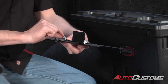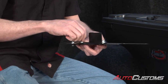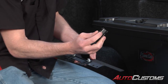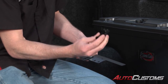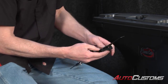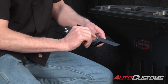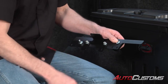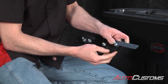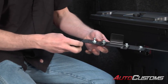Run it up through, washer smooth side towards the powder coat and nylock nut. Next we're going to take our lobe clamps. The lobe clamps have a hole that's off-centered. The high side of the lobe clamp should go to the back of the bracket, and we're going to line up the bottom lobes to the openings in that bracket. Take our washer — just like before, smooth side towards the powder coat — then take our bolt and run it through. We're just going to loosely get that bolt set in place where we can still open and close that lobe clamp.